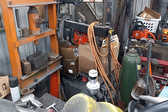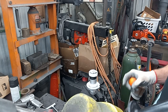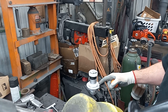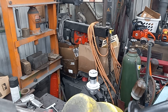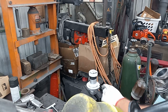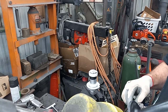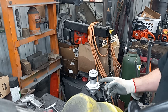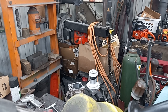And that bolt I was talking about right here, after I tighten that down, I'll take a file and go across it, make sure I got a flat spot, because that bolt sometimes sticks up and you'll catch it on your ears, and it'll put a bad spot. I couldn't quite figure out, of course I was trying to cut a Nikasil cylinder, and that bolt was ticking, and I was trying to figure out what in the heck was going on. Typically, some of the cylinders you cut have that lower skirt and it rides to the inside of it, so you never even worry about it. Steels, a lot of times they don't have that, so that's when I encountered it on a steel. So I just thought I'd share that little tip trick video.